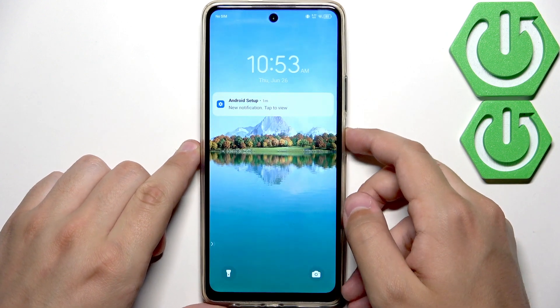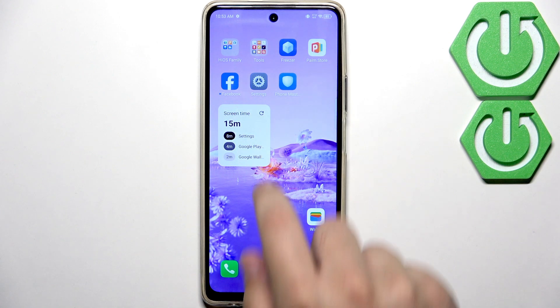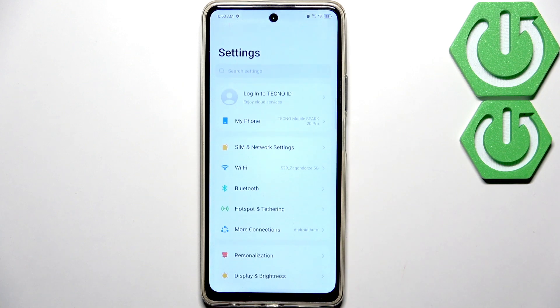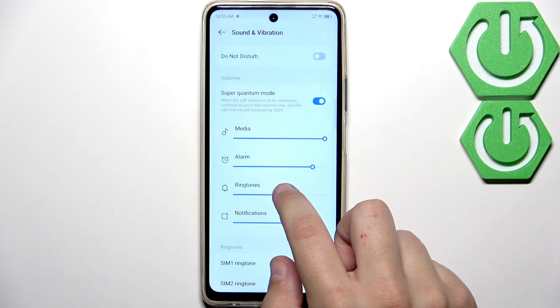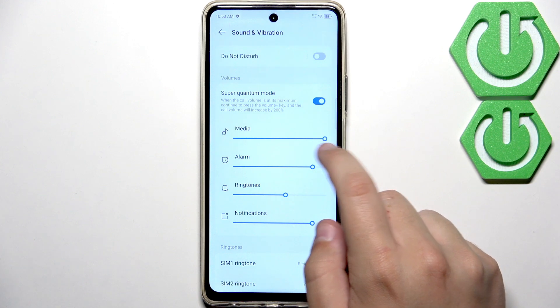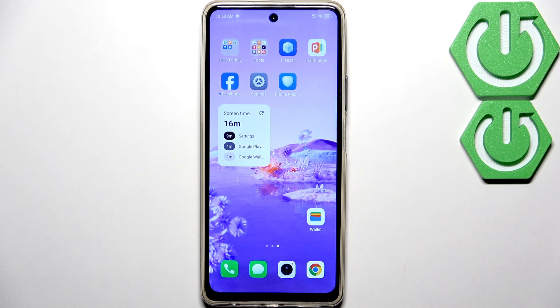First let me unlock the phone. Now we need to check the volume levels. It sounds very obvious but it's one of many reasons people think their speaker is not working. So make sure if you go to sound and vibration, everything here — even the ringtones — is set to more than half. The media volume is the most important one, so keep it at max. The alarm is not important, but ringtones and notifications should be at least more than half.